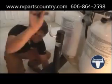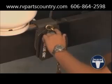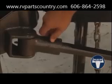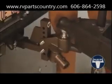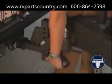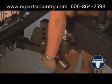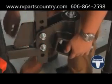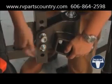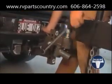Take the weight off of the towed vehicle. Release both rotating latches by rotating or pulling the bracket lock pin. Disconnect spring bars by turning 90 degrees or pulling out the pins to remove. Unhook the trailer coupler from the hitch. Remove the hitch head assembly from the receiver hitch mount by unscrewing the bolts, nuts, and washers. Move the hitch head up one hole on the hitch mount receiver and reinstall the hitch head assembly with the bolts and torque to 285 foot-pounds.